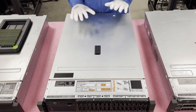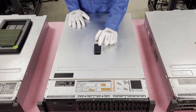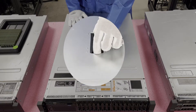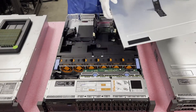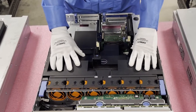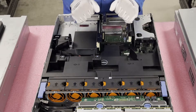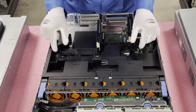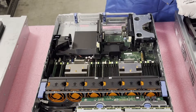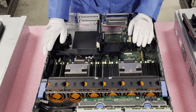Now that we have our ESD gear on, we're safe to open the machine and prevent electrostatic discharge. First things first, make sure the latch is set to unlock. If it is set to lock, you can simply grab a Phillips head and twist it over to pop it up. You'll notice there is a large air shroud, also known as an air baffle, on top controlling airflow to keep the CPUs and DIMMs cool. To get to them you need to physically pull this out — it just pulls straight up, no buttons needed. Just try not to hit anything when pulling it out, as you could potentially damage something.